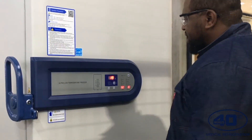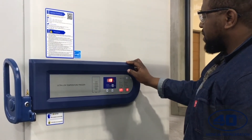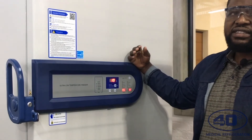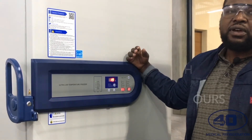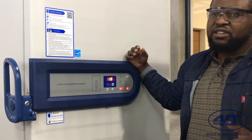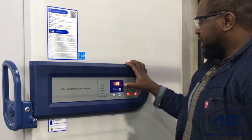You can also follow the operation procedure in the manual. Initially, I will set the freezer to minus 60. It has to be set to minus 60 for a minimum of eight hours, and afterwards I will set it to the ideal temperature — either minus 70 or minus 80. I need to monitor it for a minimum of 24 hours before putting any product inside the freezer.